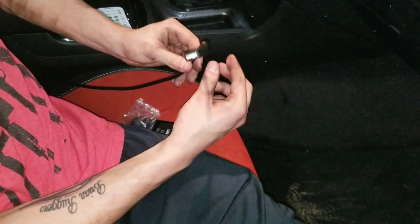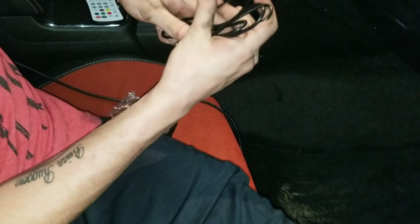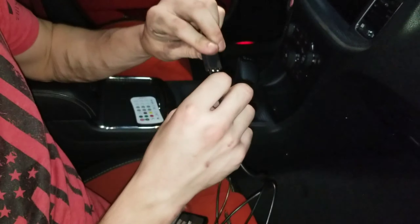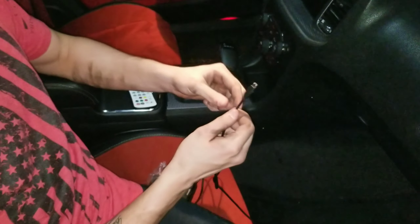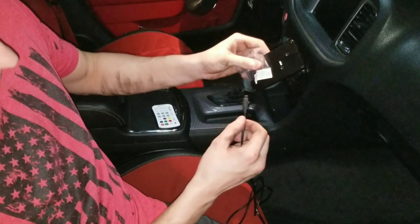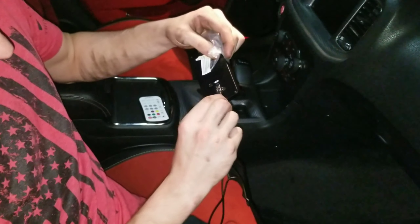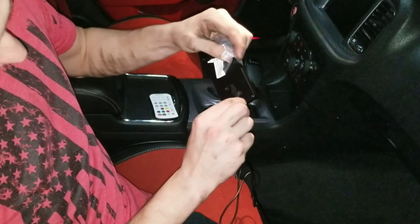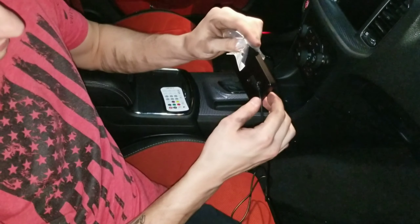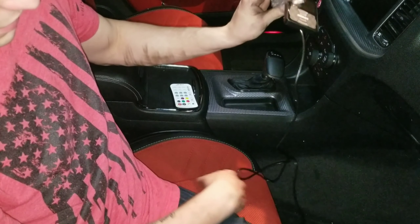This is the wire that we ran for the controller from the back wire harness. In your package, you're going to have one of these — it comes with zip ties and all your electrical fittings. This is going to plug into this end right here, basically a USB port. This says Air Lift on it — this is going to plug into the back of your remote. The easiest way to put it in: make sure it's the same way, go like this because there are two little slots it's got to slide into. Bend it up a little bit, push it in, then once it's pushed all the way in, push down right here so it clicks in — and that's that.